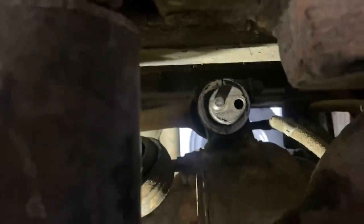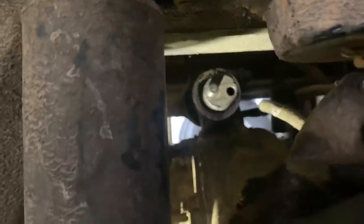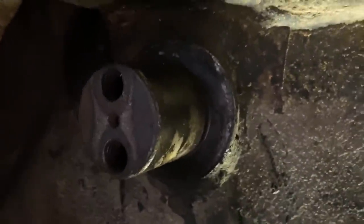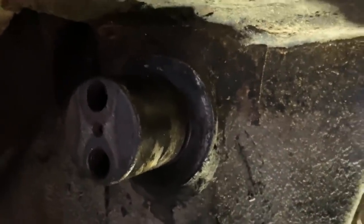So we ended up, the easiest thing to do was to remove these studs that were here, and then it came off. As the studs were stopping us, we didn't have enough room to come back without hitting this, even up in the corner there. It just made it easier. We removed that front stud there as well. Should go back on a lot easier now. Just there wasn't enough clearance in there, so. Sometimes I have these where they're bolts, and now I see why, because it's so much easier to get it in and out with the bolts. So we'll get this other one back on with the new bushings in it, and hopefully this shouldn't take too long.